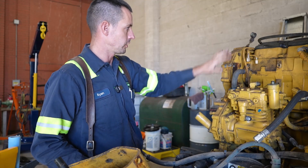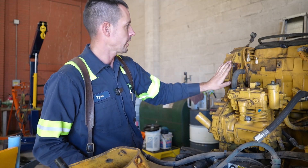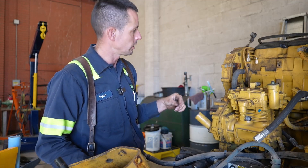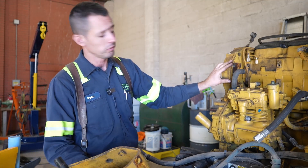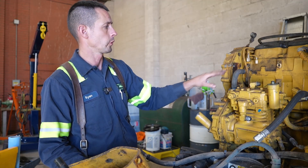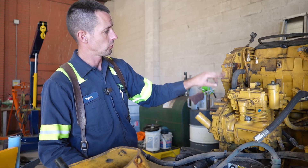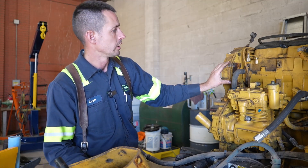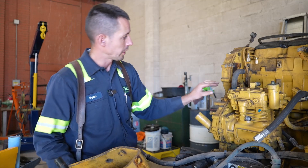Speaking with the customer, we talked about replacing the whole cover, but it's not cracked or anything, and up here where the little peanut cover goes on the front of the engine, that was in halfway decent shape. So what I've decided to do is put a helicoil — put new threads, thread repair — in both of these holes here so we can put the new bracket on and hopefully it won't leak and everybody can go on with life.